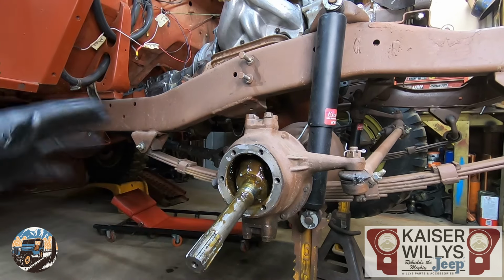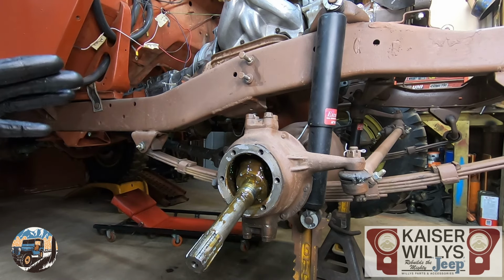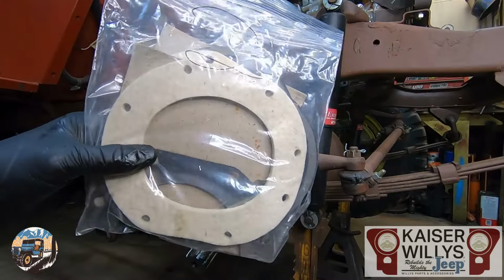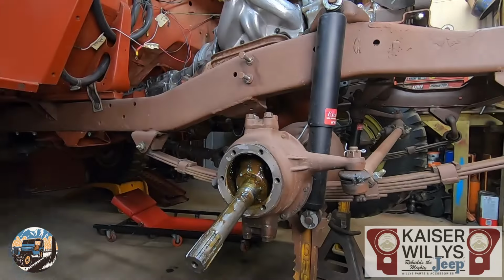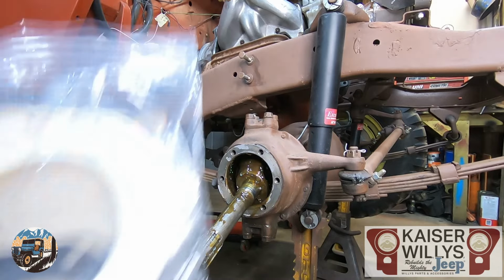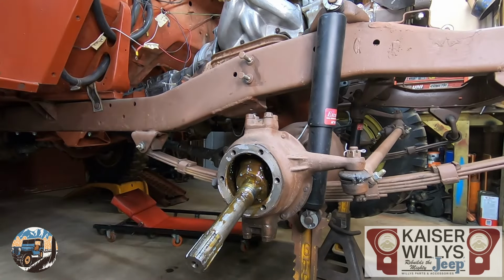Since we have the axle this far apart, now would be a great time to put a locker in or do any other maintenance up here. That would save you from having to disassemble it in the future. I'll put my locker video in the description. This is also a great time if you want to do knuckle seals or kingpin bearings or service. My knuckles leak pretty bad, so we're going to put this Kaiser Willys knuckle seal kit in while we have it to this point, and then we'll get back to the disc brake swap.